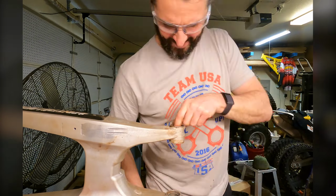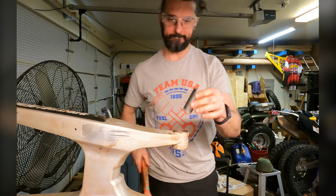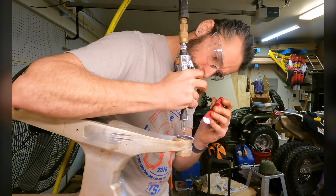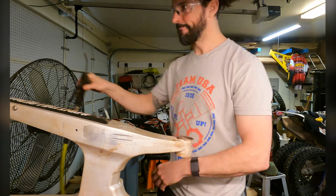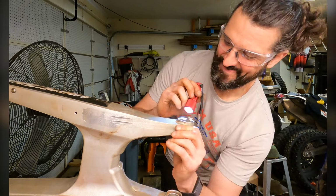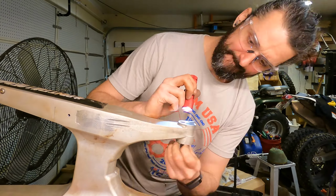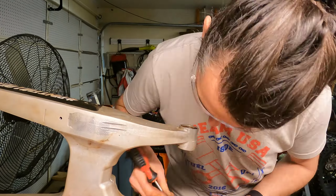Since there were two bearings pressed up against each other, after cutting one out, I wanted to see if the other one had any give to it. It didn't, so I got back to cutting it out. All in all, I didn't do too bad. I did get a slight nick in the swing arm, which I spent some time sanding down so the bearing wouldn't get caught up when pressing it in. I sent the pic to a few different mechanics and got the thumbs up.